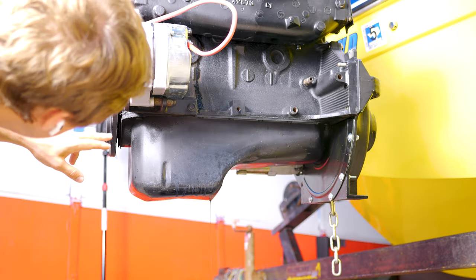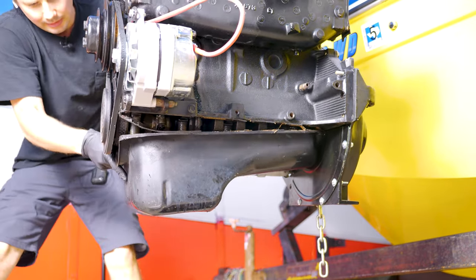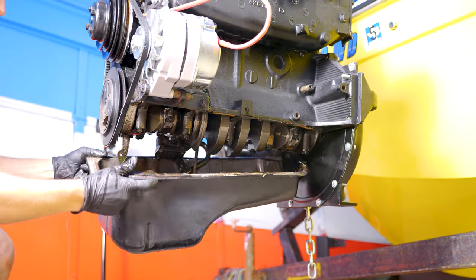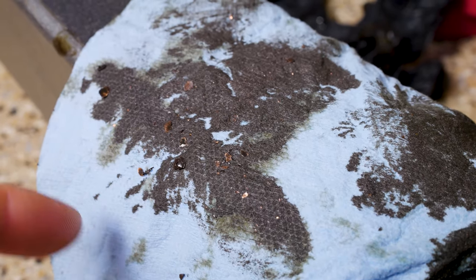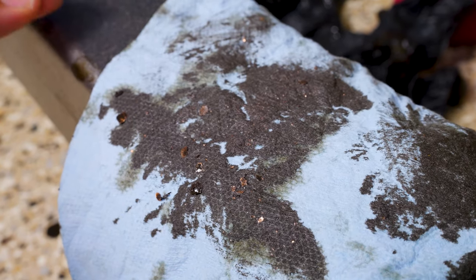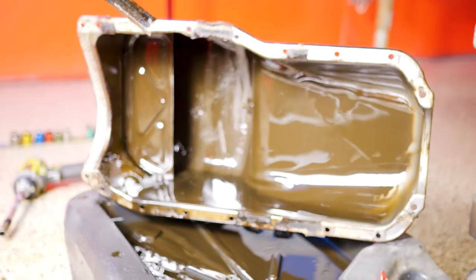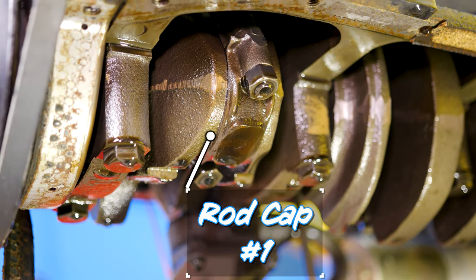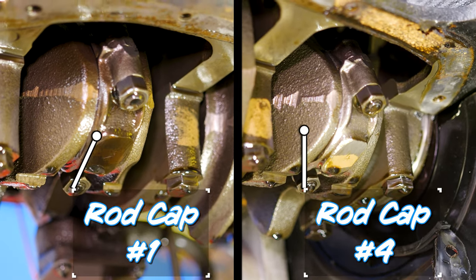Next quickest way on this engine — get the oil pan off. Here's our bearing material: shiny, shiny copper. Here's a big piece here. The oil pan is full of this kind of material. This is all bad. Having blown a few engines up, I think I know which rod bearing is spun. Number one has a different color on the end of the rod, looks a little heated up, so that's probably the one. If we take that cap off first, we'll see that that bearing is destroyed.